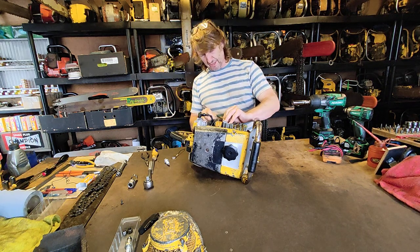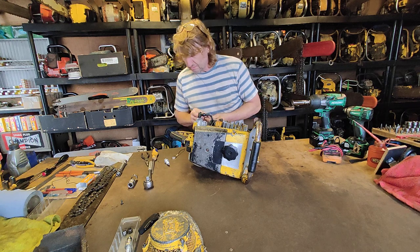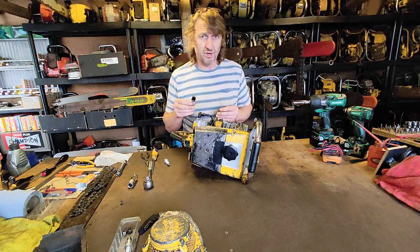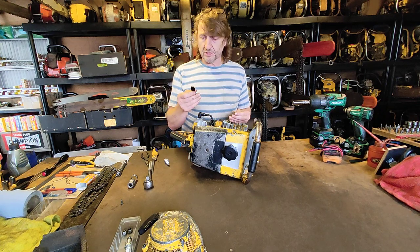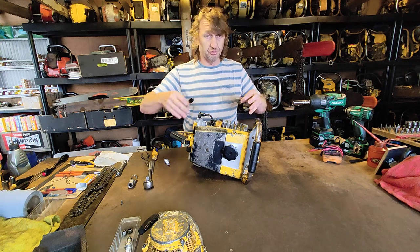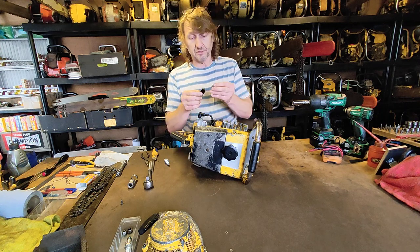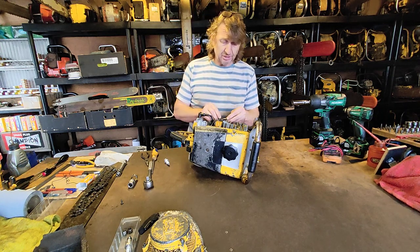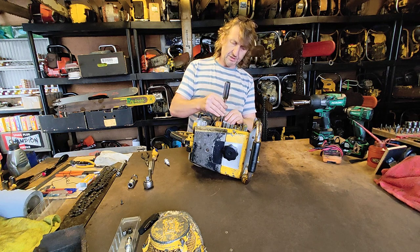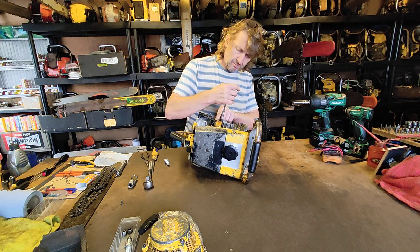So one thing I found I had to do with my ignition senders was, typically lots of components which go underneath the flywheel, you'll find they're geared up for 3mm or 4mm threads. And when you come to mount one of these, there's really nothing around the chassis which is 3 or 4mm external to the electronics or the electrics. So I've just run these through with a 5.5mm bit, so then I can mount it conveniently somewhere. And these work really, really well in close proximity to the coil. And so mounting it on the coil, I know that I'm not adding too much electrical resistance anywhere.